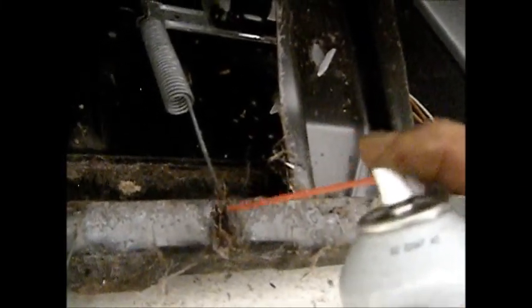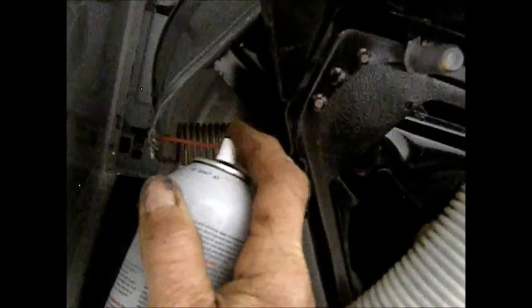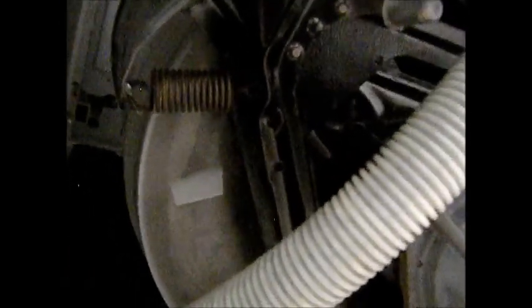Lube the brake if you hear a clunk when it stops — I've got other videos on this. Basically you just take your lube spray and spray it in there by that spring. Make sure you don't get anything on the silver clutch bell. Just lube this a little bit and anything else that looks rusty. Be careful that the seat is square when you go back together or it will give you a problem spinning. There's a tripod plate here — that thing has got to be square on there. Be careful with these hoses, they can break. That's your tip for today. Thanks for watching.